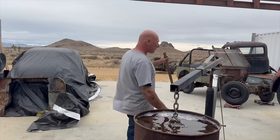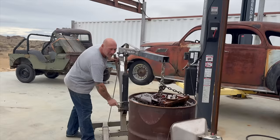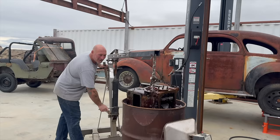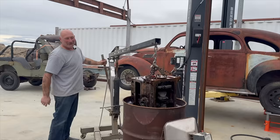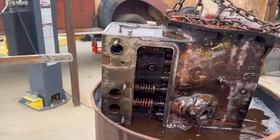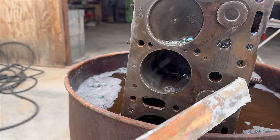Got that Jeep engine in this 55-gallon drum of alkaline degreaser. It's a Zep product, made to dilute. So it's a concentrate, and I thought, hey, that engine will fit right in there. So I got the heater on it, I just keep raising it up, blowing out the oil passages, giving it a little scrub here and there, and it's really coming back. In the cylinders I've been using a little hone now and then. Remember how beat up those were — they're coming back, they're going to be okay. So that's good news. This engine will run, for better or worse.